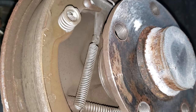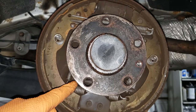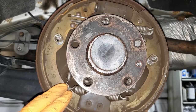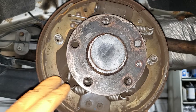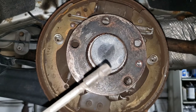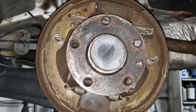As you can see, there are a hideous amount of springs on this thing — one spring here, another here, another here, a spring behind that, and two springs here and here. There's also a spring that holds the emergency brake cable in place. These springs are a pain and are just there to take your nails off or bash your finger. There are tools made specifically to get these springs, but they don't generally do a great job. This old-school spring tool works by unclamping the handle, sliding your spring into the sliver, and clamping it back down — but then you're supposed to develop superhuman strength and yank the spring off. It doesn't work well on springs like these because there's barely any meat to get the tool on.